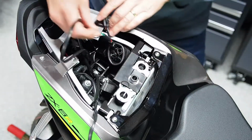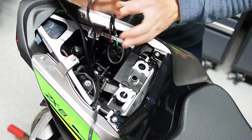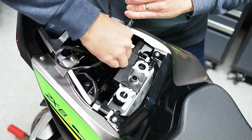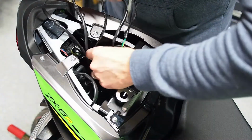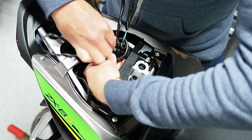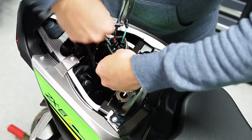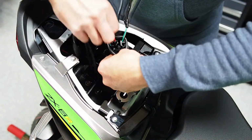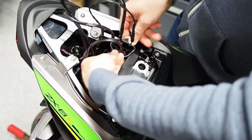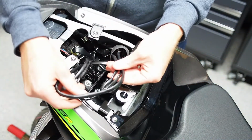Once you get there, it's pretty much black 2-pin connector to black and gray to gray, and then we'll fish out the big 3-pin connector. If you don't hear a click, again, you're going to have to go hunting for that connector. Thankfully the turn signals are much more rigid on the second half, so they're pretty easy to just push into the boot. The last connector, again, if you don't hear a click and you can't pull it back and have it stay snug, you've got a problem.